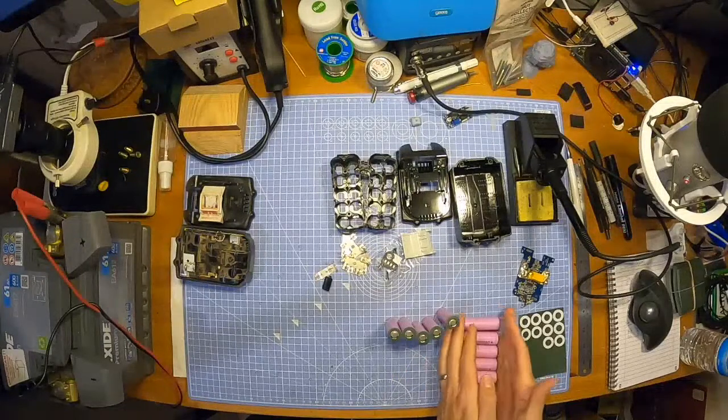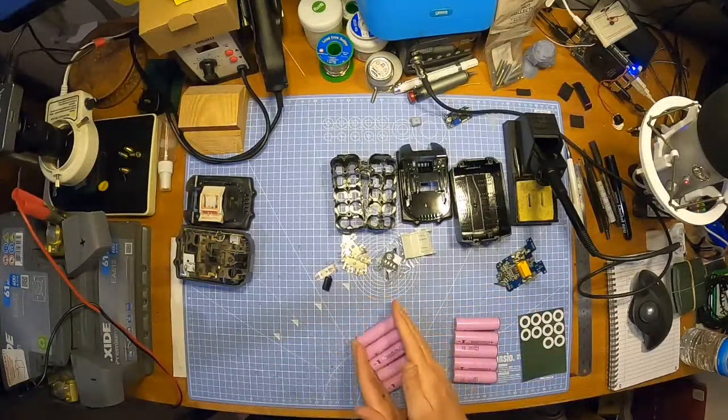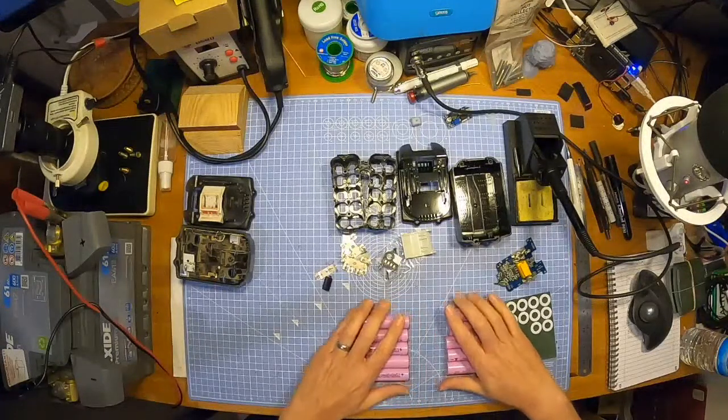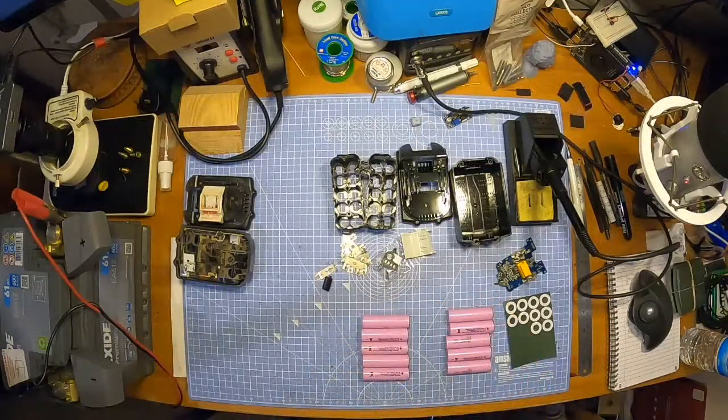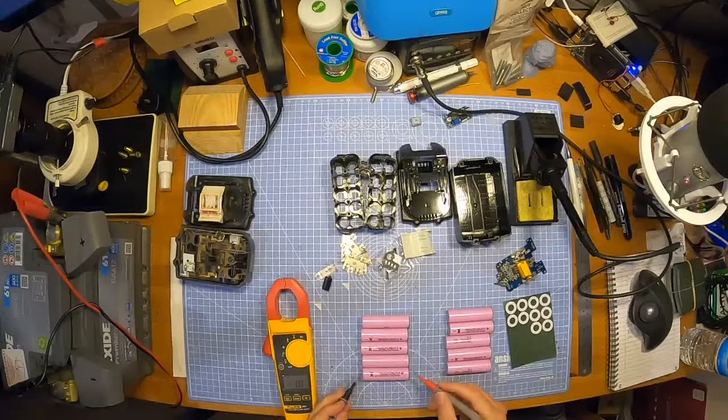These boards are balance boards, so it should be alright, but we do have 2 in parallel, so it's a good idea to check the voltages anyway, really, because if you've got a duff or dead cell, you don't want to build the whole thing and have it, like, set on fire. Which could happen, you know. I've seen it happen before.